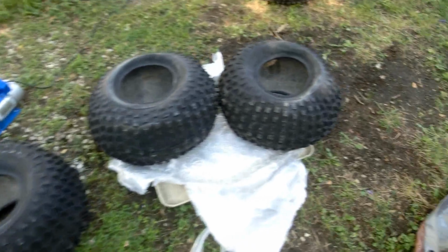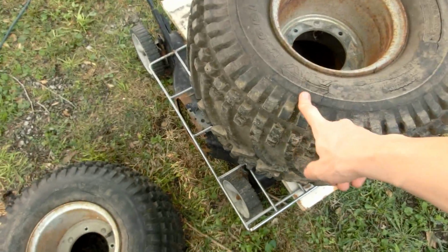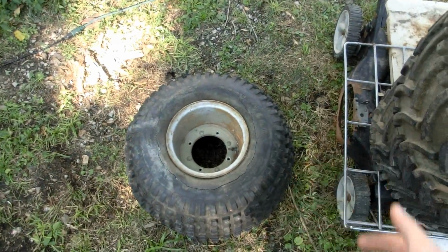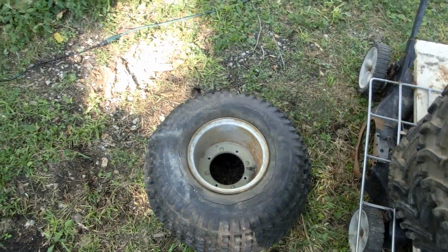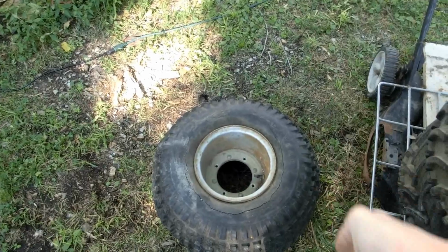Well, that was quite nice. I think I just have to put those on the rims, air them up a little bit, and those should go the right size. Now the question is how to get the tires off of the rims. I think if I pull a vacuum on one of the tires, it might break the bead, at least on one side, and that will help a lot, but I might still have to make a machine, a tire demounter that would break the bead manually.